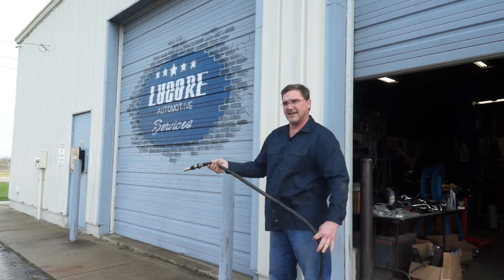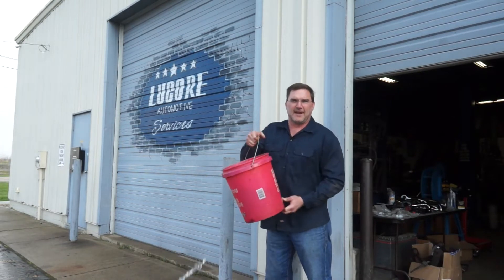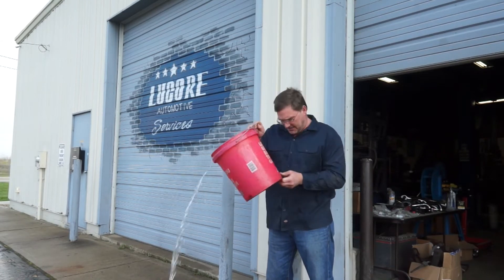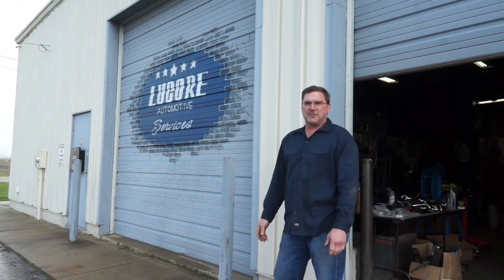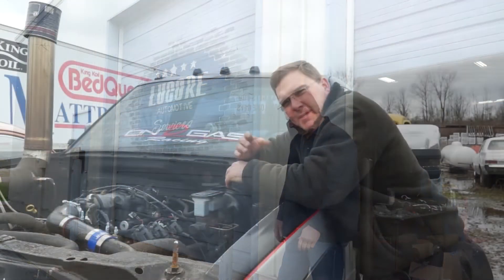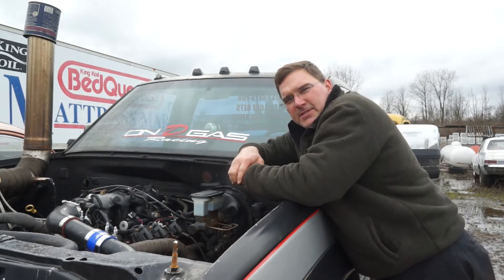When you uncap your fuel injector, you get something a little bit more like this every time the injector fires. If you don't know what that fuel rate is, you're going to completely overfuel your engine and then bad things happen — you buy another engine at the junkyard because you just blew that one up. Uncapping injectors will give you more power and more fuel flow, but you don't know how much is going into the cylinders.